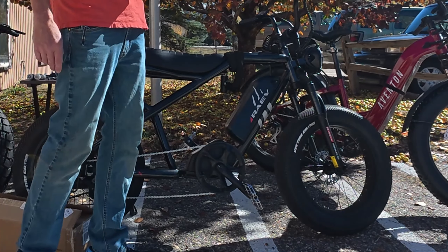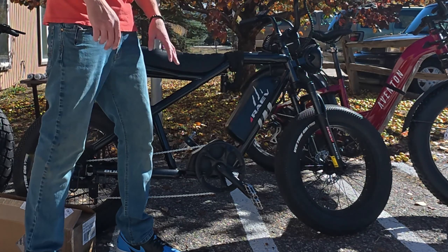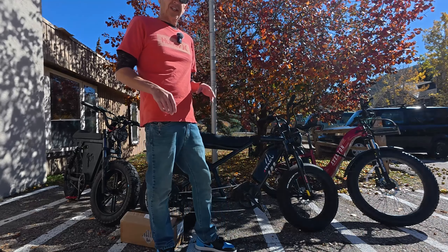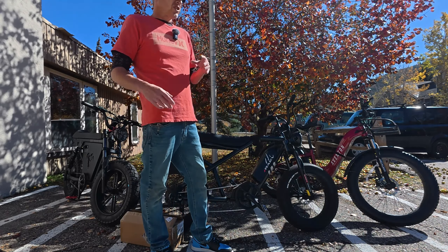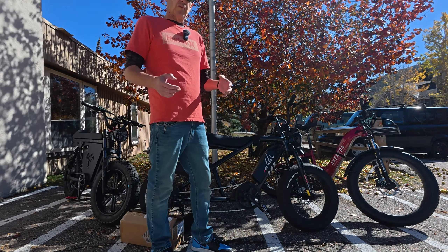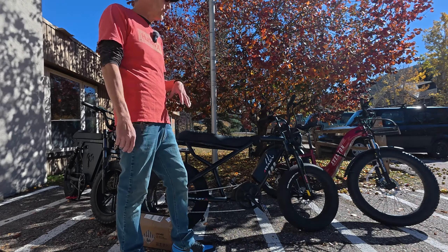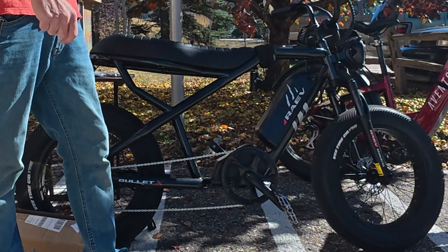This tutorial will show you an easy and, more importantly, a safe way to do this dual battery system setup. What that is going to help do is ease range anxiety. A lot of these 13 amp hour batteries come with more than enough for traveling around town, but if you're like me and live in the Colorado Rockies, you want something bigger. We're going to add 26 amp hours on a 48 volt system, which should give you at least a 30–35 mile range.